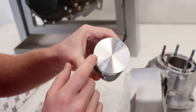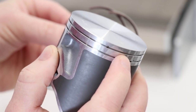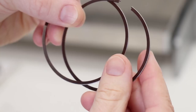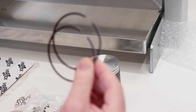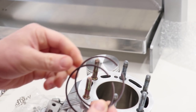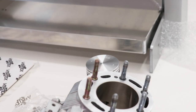I'm gonna get it ready to slide onto the rod by installing the piston rings and one of the piston pin circlips. This is a dual ring piston, so I'll be installing the bottom ring first followed by the top. The rings look identical from top to bottom and they're marked right here with a T, so any markings should be facing up. On two-stroke pistons they make it pretty simple — there's a pin where the ring end gap lines up. Actually, before I slide the rings onto the piston, I'm gonna set the ring end gap with the cylinder.